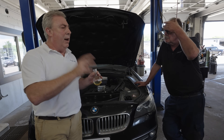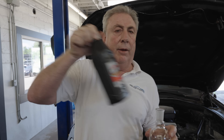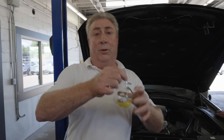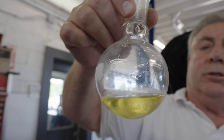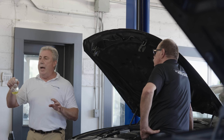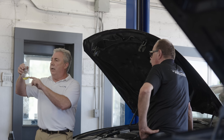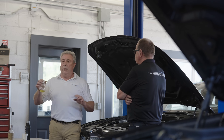It's not so much a mileage thing, but a time thing. Here's an example of what's going on. This is the brake fluid product we like — it's a BG product. We're using DOT4 in this car. This is just pure brake fluid right here. We're going to add a splash of water — you'll notice there's no separation here. This material is dissolving the water; it's a completely homogenous solution. It looks like brake fluid, looks the same as before I added the water. But something happens: these cars have become more sensitive, more affected by moisture content in the brake fluid than with previous systems, which were much bigger design and more forgiving.